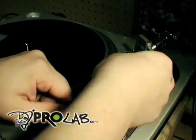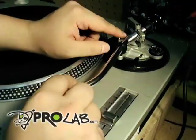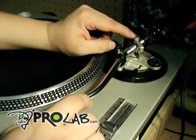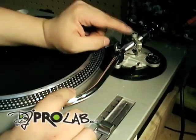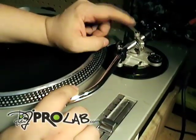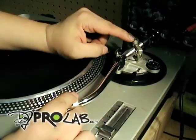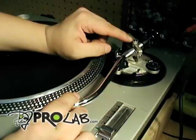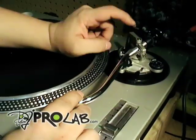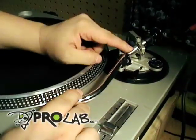There are two ways we can combat this. The preferred method is to replace the entire tone arm. The other method, if you're at a gig and it's crucial that you fix this on the spot immediately, is to loosen the screw on the top here. Don't do this unless it's absolutely 100% necessary — an emergency situation. Once you mess with this screw, called the pivoting screw, it's next to impossible to get it back to the way it should be. These are machine-calibrated screws at the factory. It'll take about three hours to calibrate this versus 45 minutes to replace the entire tone arm, so it's much cheaper to replace the tone arm.